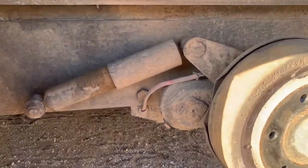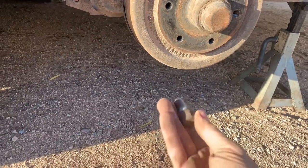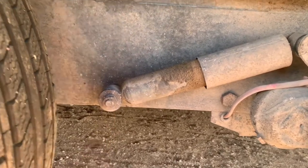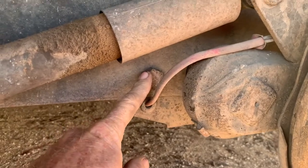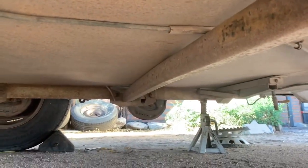Pretty simple — obviously take off the wheel. It's still pretty old-school hubs. It has lug bolts versus lug nuts. That is a three-quarter nut. Take that off, and then there's one bolt right here, 15 sixteenths. There's a nut on the back side, and there's another one over here that corresponds with that 15 sixteenths nut on the inside. Same thing.